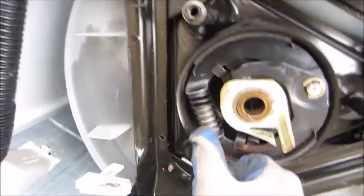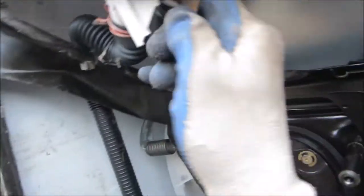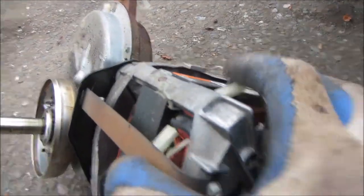This actually doesn't seem too stiff. We're also going to lube the motor shaft to make sure that's running freely, and check the water pump to see if it's stiff. Sometimes if there's something in this water pump it will cause that clicking sound, or the motor might not even start. These motors have a resettable overheat fuse — a thermal cutoff — and if they heat up they'll shut down. If you have something stuck in your water pump the motor could shut down.